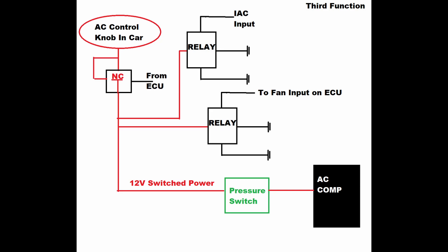The last thing you have to wire is a way to turn off your AC compressor at full throttle. How you do this is run your AC compressor power wire through the normally closed terminals on a relay. The Holley ECU provides a ground output which will shut off the AC compressor at full throttle, and that goes to one side of the relay — the other two sides are just connected. There are a lot of relays on this one wire, but I assure you this works.